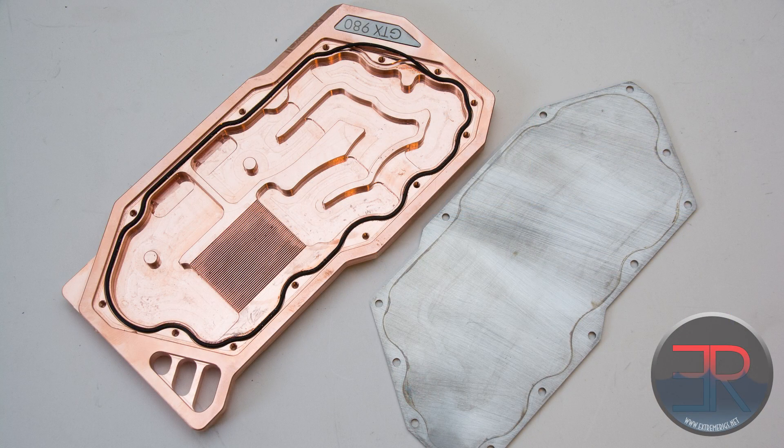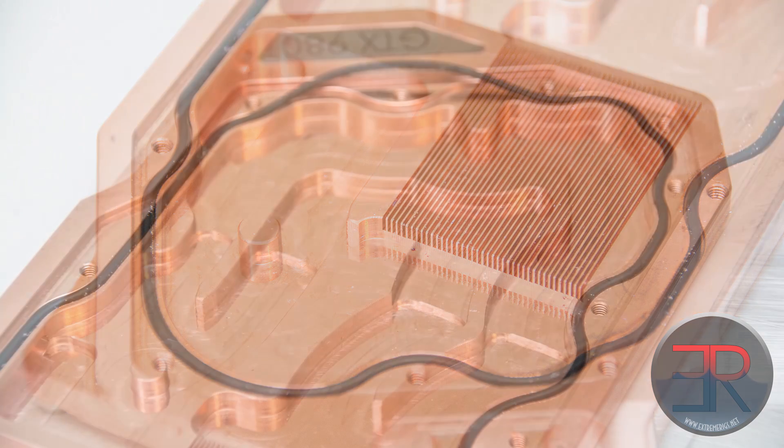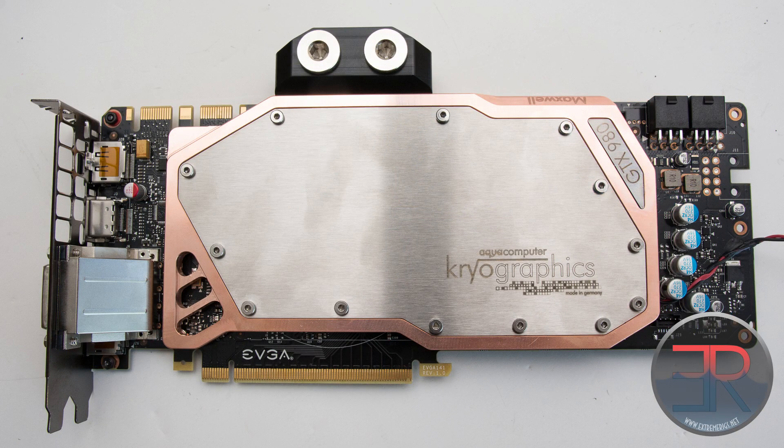Overall, that's really where the block shines. Yes, the core cooling is okay and it could be better, and we hope AquaComputer focuses on that next time. But this block is really about the VRM cooling - that's the story, and it does what it says. The active backplate does help, but honestly the temperatures with the regular mini backplate are good enough that you really don't need it - it's only if you want the looks or the last ounce of performance. We love the looks and the quality of the block overall. The only things we can really fault are the compatibility issues and wishing core cooling was just a little bit better. Otherwise, a great block. We'll be back with more 980 blocks and more reviews in general, so subscribe to the channel if you like what we're up to.